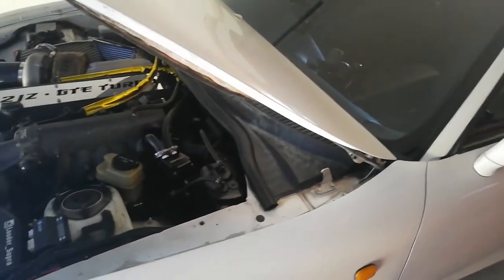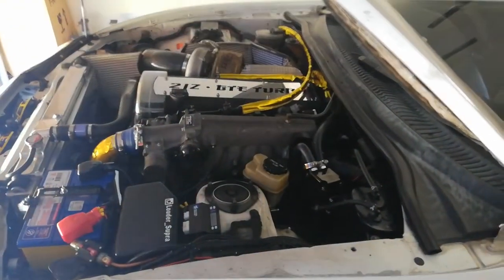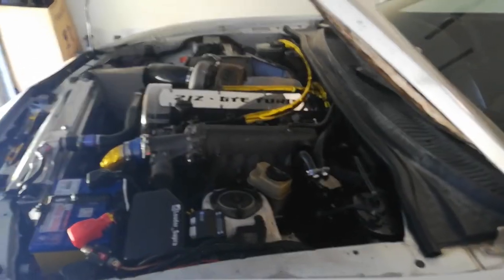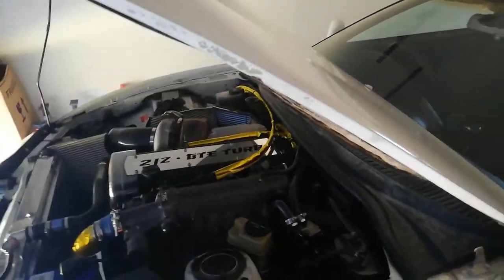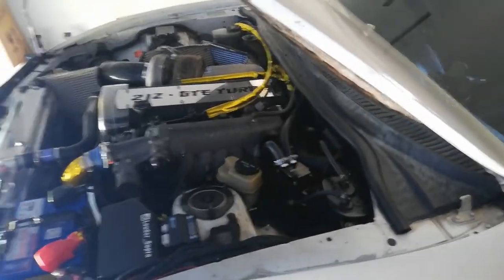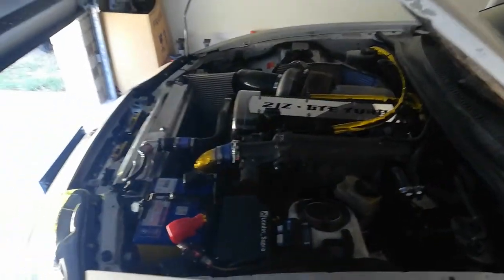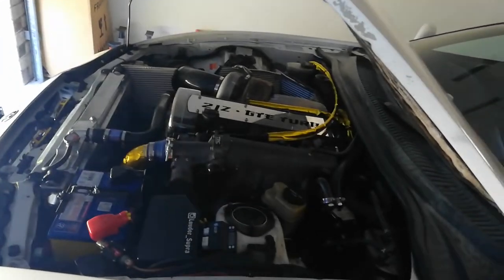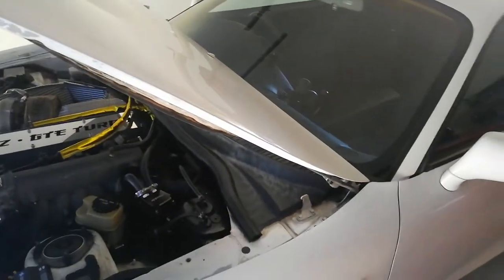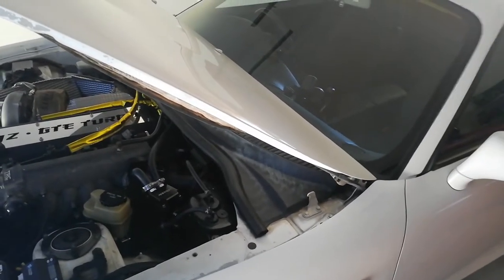I figured out how to deal with the axle tramp issue — you just start in second gear if you want to do something crazy. The car is running pretty good overall and it's now at 107,000 kilometers. I'm going to do a big major service at 110k — oil, oil filters, spark plugs, and even though the gearbox is fairly new with less than 5,000 k's on it, I'll change its oil too since it still has the running-in oil.